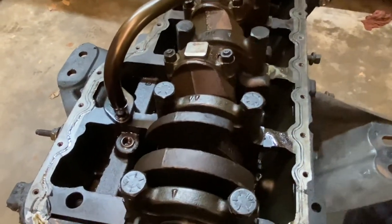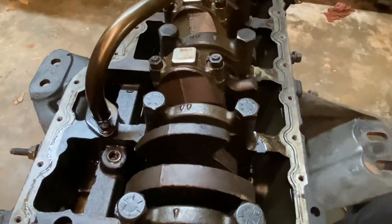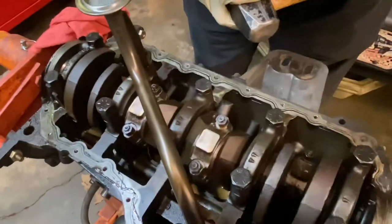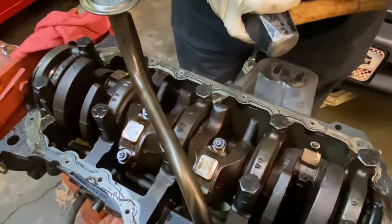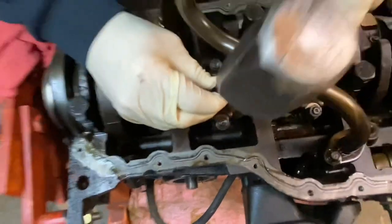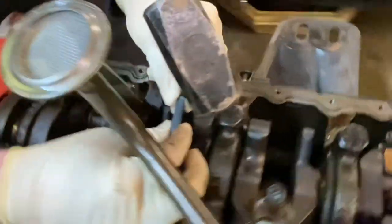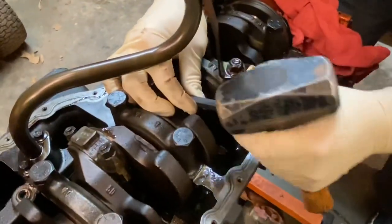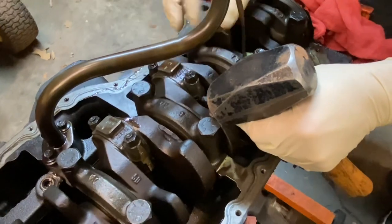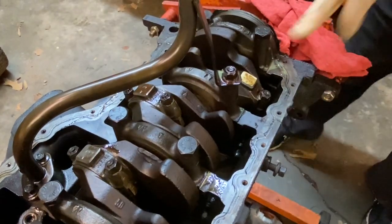Let me grab our stamp for number three — here's number three right here. Let's go up top, make sure we've got it turned the right way, and let me rotate this engine with the ratchet on the end. I've already made the V on this one. There's our three on the end of the cap. We're going to come around on the side — I've got to work around this oil pump pipe. We've got a stamp there for our three, and there we go — we got it marked on that side as well.